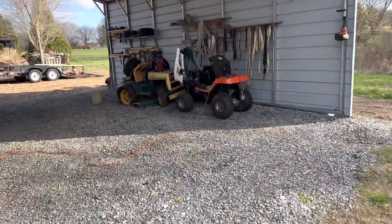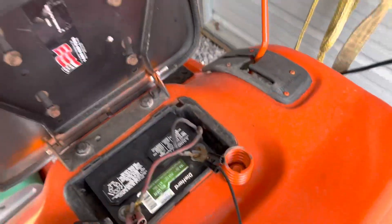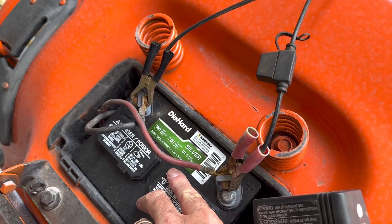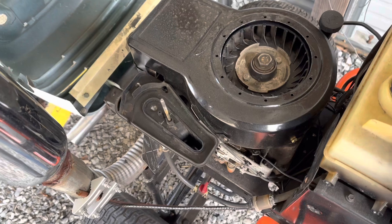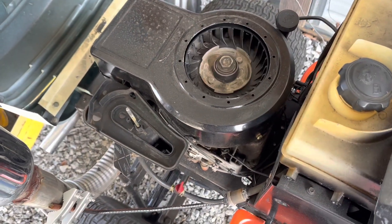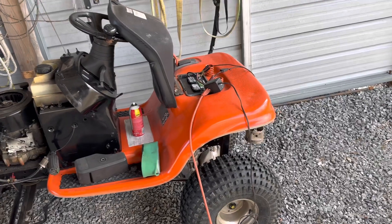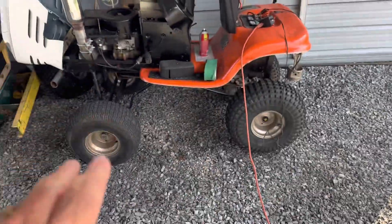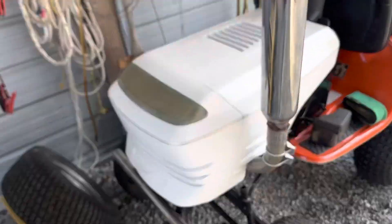I've got trailers there — I'm just hauling around firewood and it runs. I'll tell you what I did — I tried to save $20 and bought a smaller battery for it the other day. I never do this. I always buy the biggest, baddest batteries they make — that's the 160 amp. It's just not turning it over fast enough, I think, because it ran the other day. It's just not getting turned over good enough to start. I'm probably going to take that back tomorrow and do a swap. It's a lifted mower, it's a Craftsman. Everything about it runs — it's just got a weak battery.